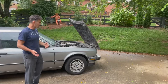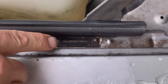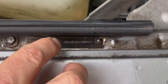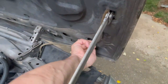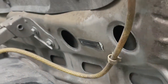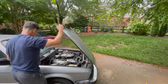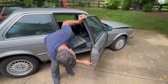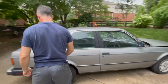Now we're going to check the passenger side of the car. The first thing we're going to look at is the sticker right here — you'll see it's got the original BMW VIN ending in 4593. If this was not an original fender, it would have a dot and a number on it, or you wouldn't find the sticker at all. Also right here on the hood, I can clean this off and you'll see the original hood ending in 4593 — so we know the entire front of the car is original, which means the core support is probably original too. We also check the passenger door and we've got an original sticker ending in 4593.